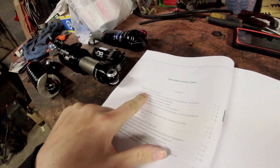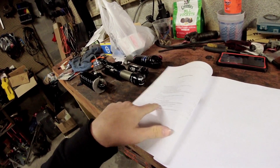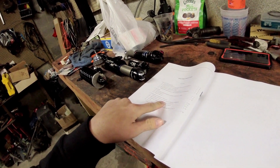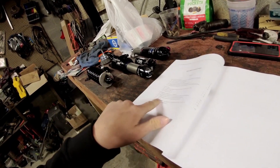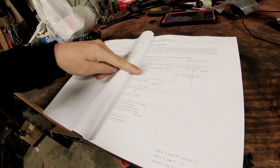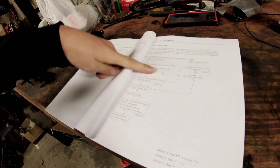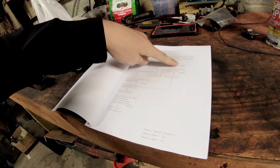The book goes through rotary troubleshooting topics like high oil consumption, overheating, and inadequate compression, along with judgment criteria for compression testing. For example, there's a nice flowchart: 'High oil consumption — is the consumption rate experienced by customers less than a certain miles-per-quart threshold?' You follow yes or no branches from there.